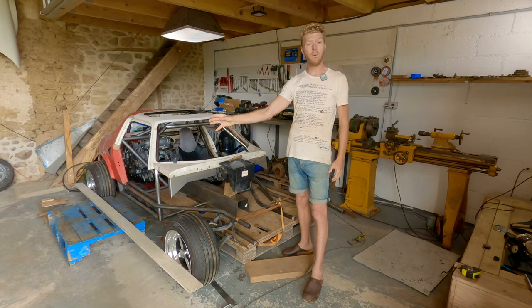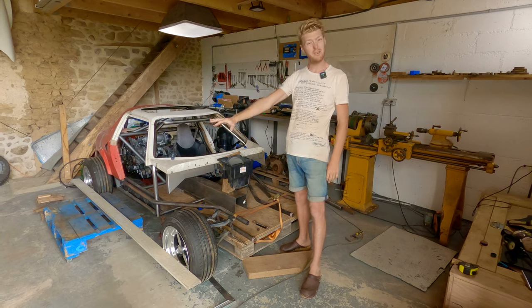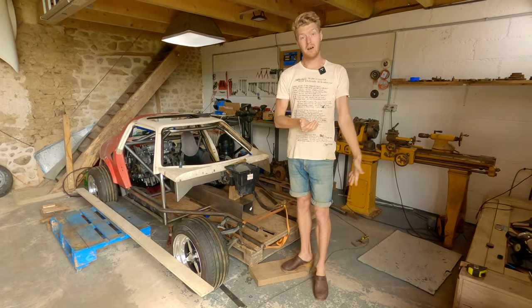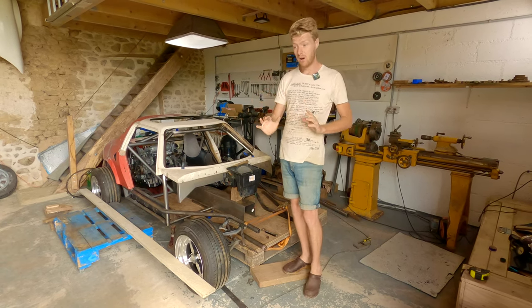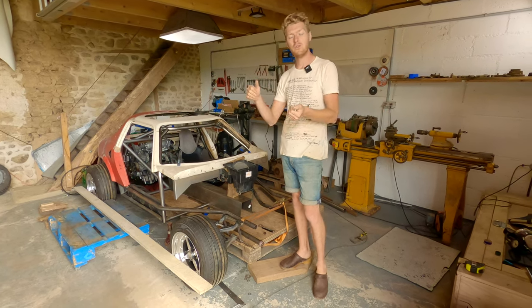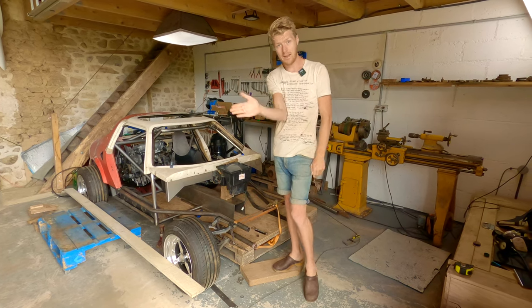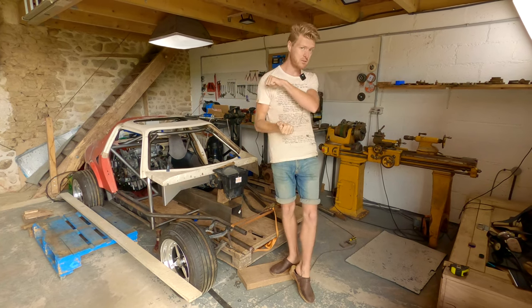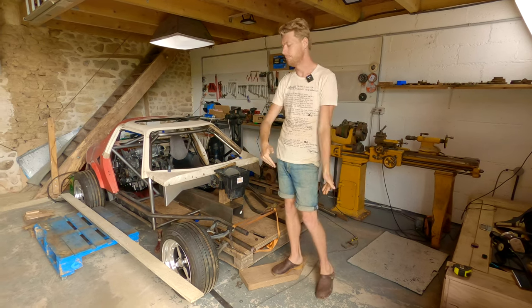And all-wheel drive cars are front-wheel drive until they're not, until they shove a bit of power to the back, but they're still front-wheel drive fundamentally. We have a tendency to understeer. Drift cars are also usually wider at the front than they are at the rear. That's because they want really good command and control of that front end in order to keep that back end sliding and do transitions, so they can slide it one way and then transition to sliding it the other way without having understeer, which would obviously cause the front to slide straight, which isn't what they want.